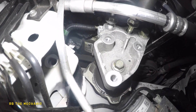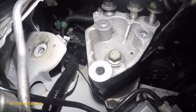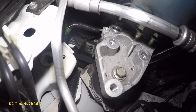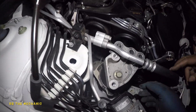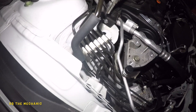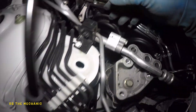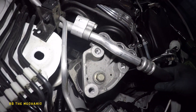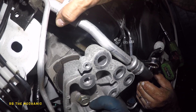I'm gonna have to go up on my air compressor. I got the compressor running. I'm just gonna try to drop a little bit because of all the weight. So one, two. I'm gonna keep everything in order. Now this should just come out. This AC line is bothering us — I'll remove that 10-millimeter. I'll just take off this guy right here. There was a 10-millimeter holding this ground down here, so make sure you put that back too. The AC line should move and give me some freedom. There you have it — the whole mount assembly.